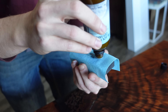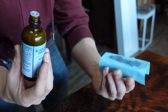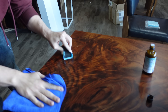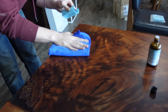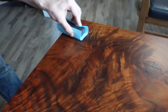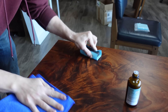The first thing you'll see is it's very dark in color — that's the actual graphene that's in there. I'm going to have my applicator in one hand, my microfiber to buff off in the other, and you're going to see what I mean about instantly buffing it off. I'm working very, very quickly here. The biggest difference with our graphene versus the ceramic when it comes to application is this is going to set up and cure a lot quicker — you almost have to instantly buff it off, whereas with the ceramic you could do a larger section and then come back and buff it off. You do get the benefits of increased durability — more scratch and abrasion resistance.